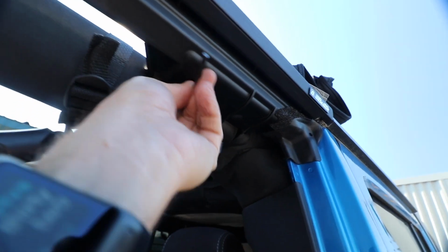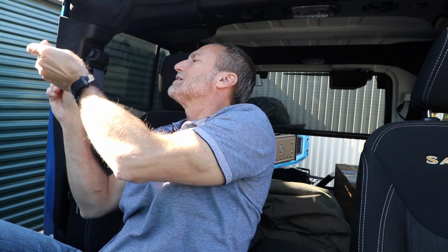Now we've got a small flange we're going to install underneath the Sunrider, and it actually connects and sort of presses up against the original hardtop to perform a nice tight seal. So that goes in with the flange screws and the 4mm Allen key. Awesome, everything lines up real good. On to the next side. Now that we've installed the flanges, it's time to tighten up all those knobs that we left loose so we had some room to line things up.